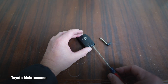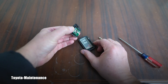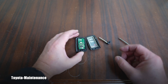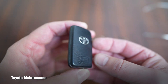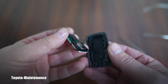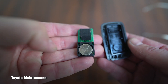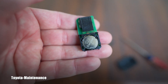The next step is having this side up. There is a notch right here which was covered by that key — that's why we had to remove it. So in that notch I will put a flat screwdriver and carefully separate these two parts; it will pop from each other. And we will replace the battery. I don't need to pry on anything with a screwdriver — just your nail is okay. It's saying CR1632 Energizer. Plus goes up — just note the battery goes in plus-side up. The battery is held by like three tabs.